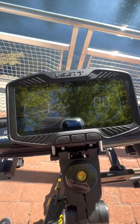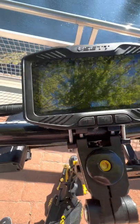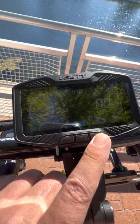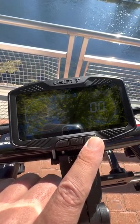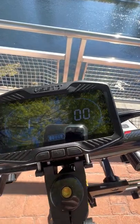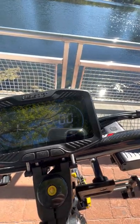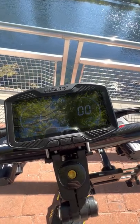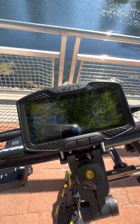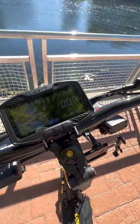At P18 where you add a new NFC card, you can also take them away. Go to P18, press and hold the minus button — it doesn't matter whether it's this display or the old display — hold it for about five seconds and you'll see 003 go to 000. At that point, power off the display and power it back on, and there it is: no more NFC card needed. I can't stand NFC cards. I wouldn't leave this scooter out in public and I damn sure wouldn't trust it to just an NFC card — it's too nice of a scooter to leave unattended.